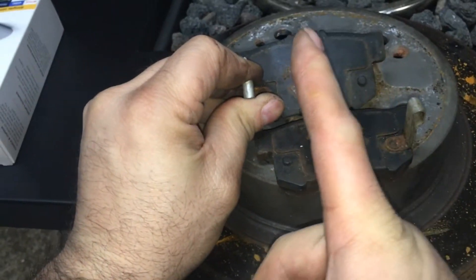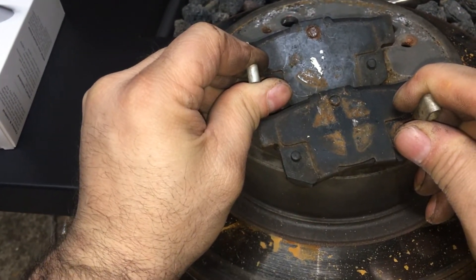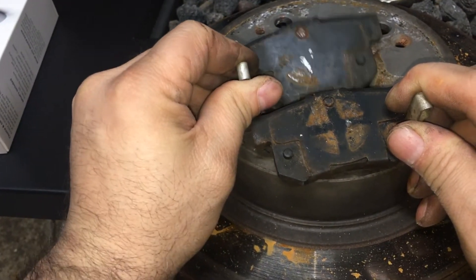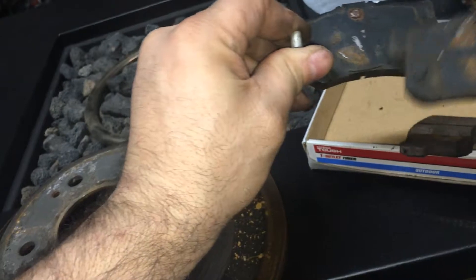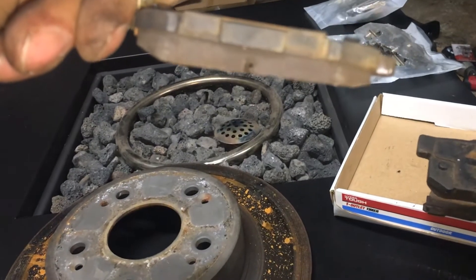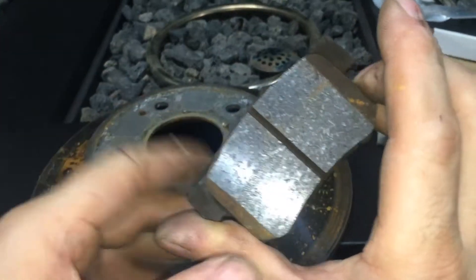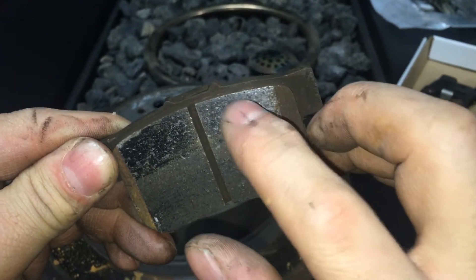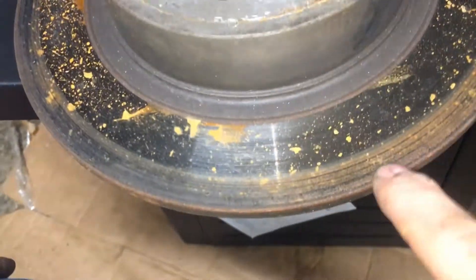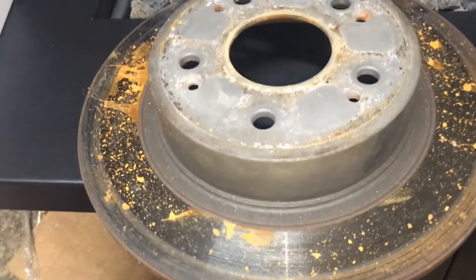That's what happens when you install these wrong — the piston was not turned enough. This piston needed to be turned a little bit more. You screw the pad because it starts wearing on an angle — it's wearing on an angle and puts pressure down on the lower area, so the top of the pad is not being used. You will get uneven wear on the rotor, and this area will just constantly stay rusted. You'll wonder why it isn't using the whole rotor.